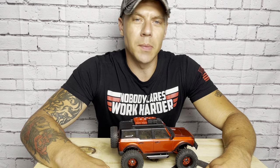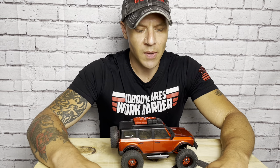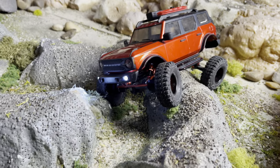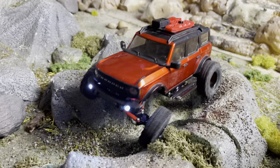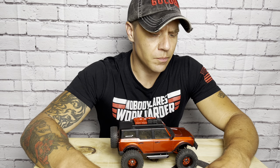Bronco Build Phase 4 — what do you guys think? I'm on the fence here. Impressed with the upgrades — the wide track really makes a difference for stability and it certainly improved the articulation, the ability for this thing to carry itself a lot better through uneven terrain. It reminded me of the JL where the body stayed pretty steady through articulation alley and the wheels were just dropping and articulating all over the place.